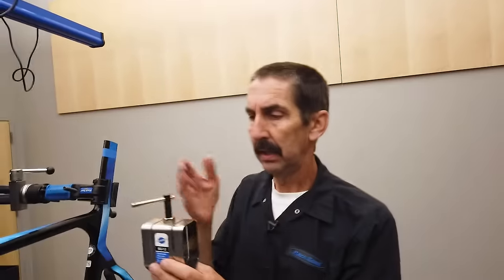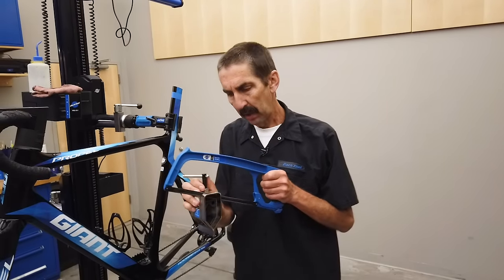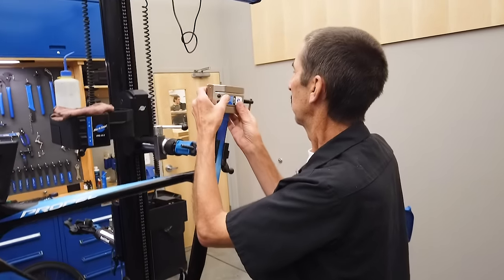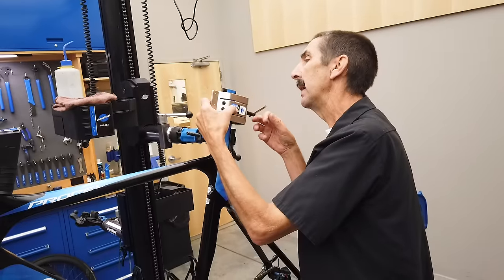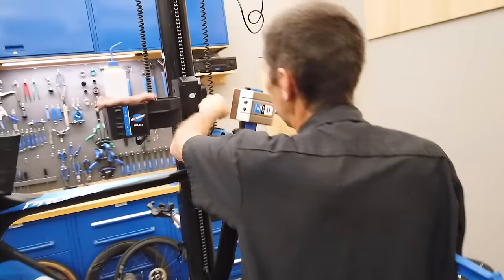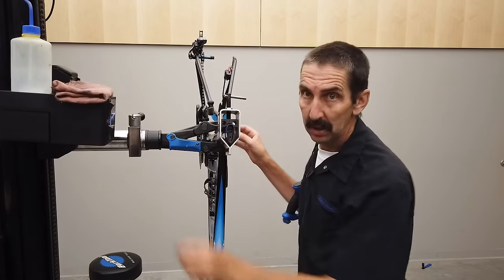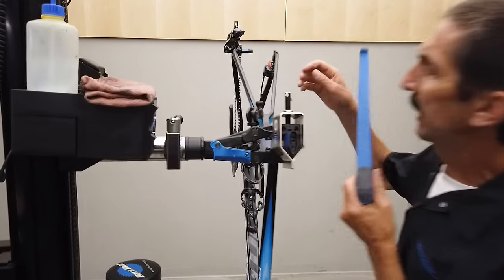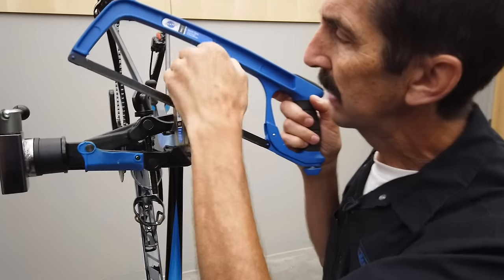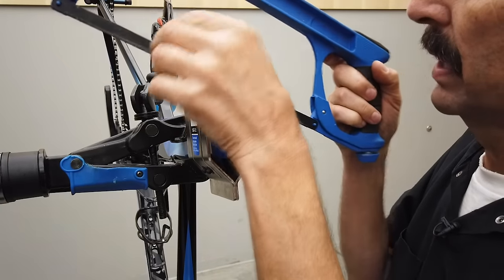We're going to use a saw guide here. The wider blade — so-called ceramic cut, diamond grit — grinds the carbon fiber. The narrow one is for steel. I'm going to install this — just eyeball it at first. That's kind of awkward, so let's tilt the bike. That's better — easier working now, and I get a better idea. I lay my blade in, I want to see that mark — it's right there. Snug it, check it twice. I think that's good.